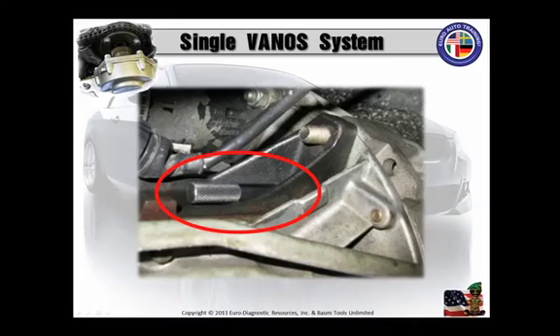If the lock pin does not fully insert, or the crankshaft pulley is not locked, adjust the crankshaft pulley with slight increments of back-and-forth movement. Don't beat on that pin — because especially for you guys up in the rust belt, it may be blocked by rust, debris, or dirt, and you're going to bend the flywheel. A little finesse here — if it can't slip in, beating it with a hammer is not the way to do it.